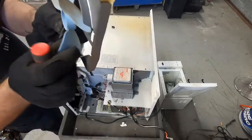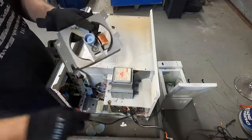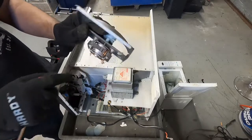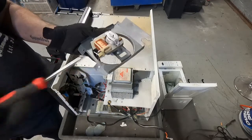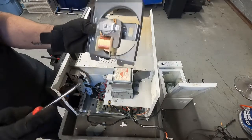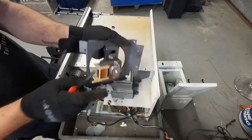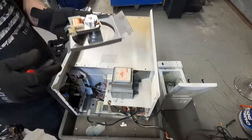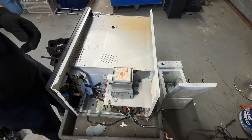The screw was hidden underneath the fan blade here. These are plastic - I just break it right off and then I can get to those screws. Once the motor is out, I just pull this plastic piece off. There is aluminum here - like I said in the previous video, this circular piece is iron-y aluminum. This is steel. And then here's the copper - to get these out, there's little edges that go all the way through on both sides. Just put it in the vise, give it a couple taps, and this will pop right off.